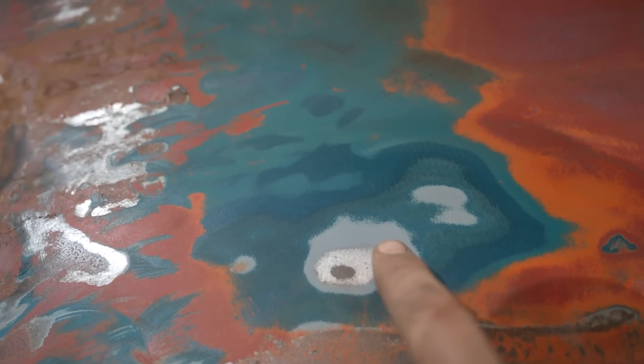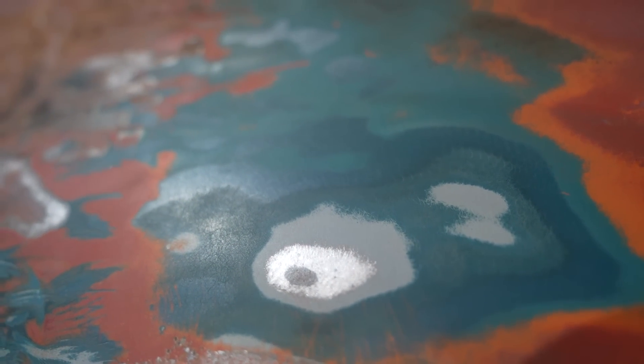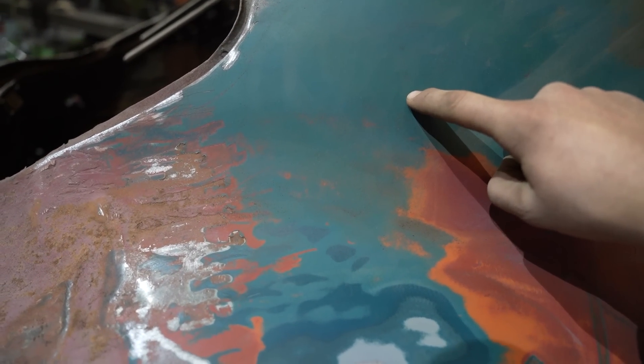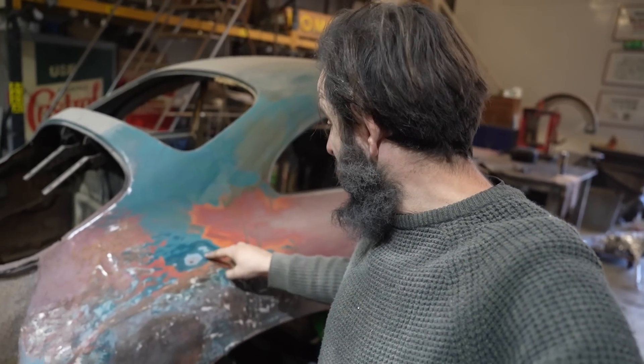You can see the layers — it's almost like a tree, like the rings of a tree. There's bare metal, then a gray primer, then a lovely sort of sea blue colour, then a darker one, and then a lighter one. This colour that's all over here is on top of that blue, that gray, and then the bare metal. There's no way that this colour is the original paint because it's got two different blues underneath it. I've got some really good references of absolute original paint — the glove box door, bits of the interior hidden behind the doors.